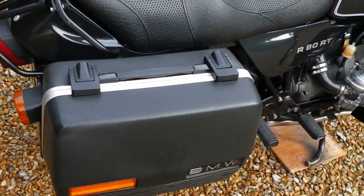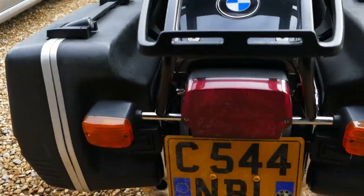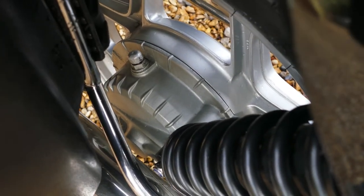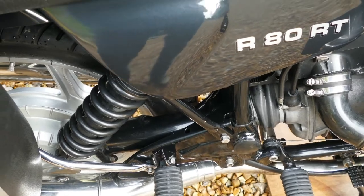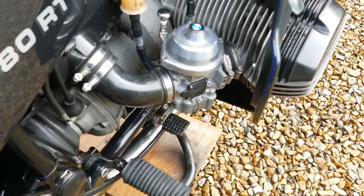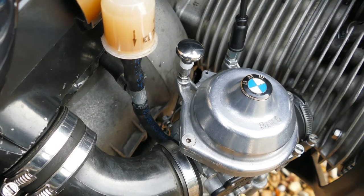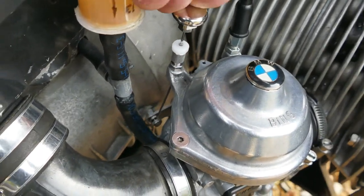So these come with it — the panniers. There's an LED in there. Everything works. It's got a long MOT. Clean and tidy. All the oil's been done. However, I'm supplying with it an oil filter and rings and kit because if you're like me you don't trust anybody. Everybody's a liar and I would change the oil anyway. Carbs rebuilt, both of them, and fitted with these manually operated chokes because the cables were just a pain and you could never guarantee they always went home. With these, you can — they're either open or they're closed.